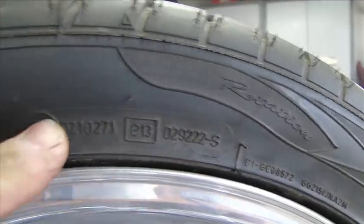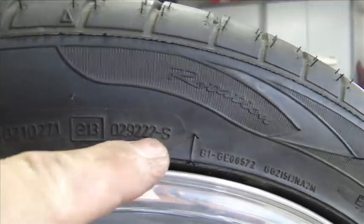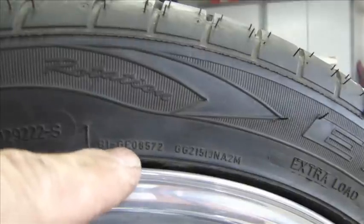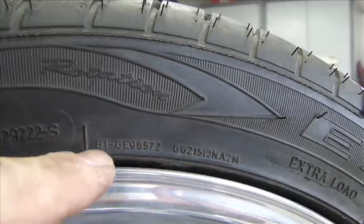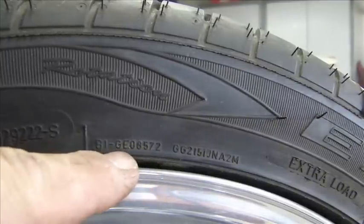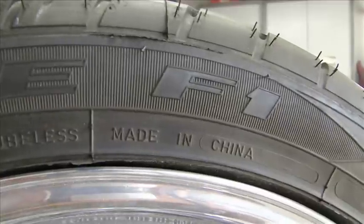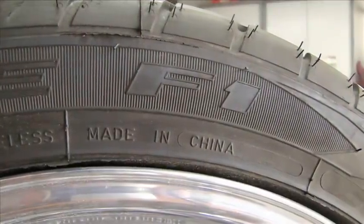These are serial numbers and catalog numbers — how it's listed in the catalog and in the system. It will often have the green tire number that was built; this looks like 210271 is the green tire number, and here's the finished product number. You'll also have mold numbers — usually six numbers followed by letters. This looks like mold number 81. It also tells you the extra load rating, that it's a radial tubeless tire, and of course the ever-famous 'made in China.' Here we have a Goodyear Eagle F1 tire, and they're made in China — not even made in America anymore. So that's how you read a sidewall.